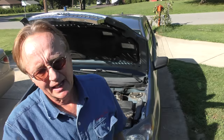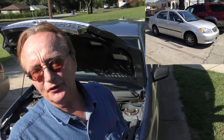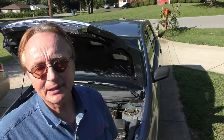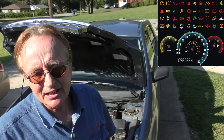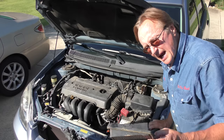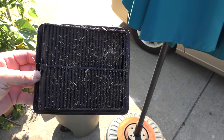The next thing I want to warn you about is as simple as it comes: don't have a dirty air filter. Most modern cars don't need the maintenance they used to — no tune-ups, no grease fittings — so most people just drive them and don't do any maintenance other than changing the oil and filter. I had a customer bring me a Toyota Matrix — basically an SUV version of a Toyota Corolla — and it was running like crap. It would idle okay, but when you accelerated it lost power. The check engine light was on, so rather than waste time doing a million checks, I just popped out the air filter. I doubt it had ever been changed.